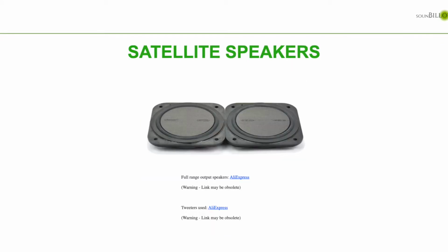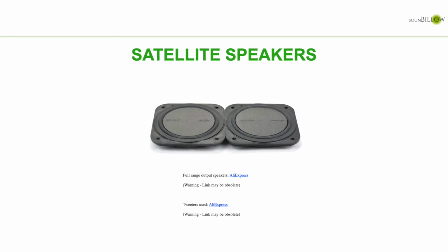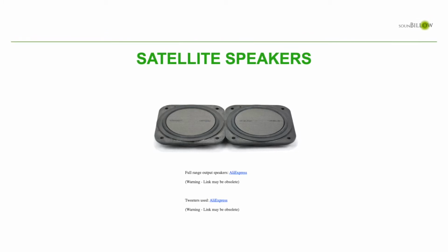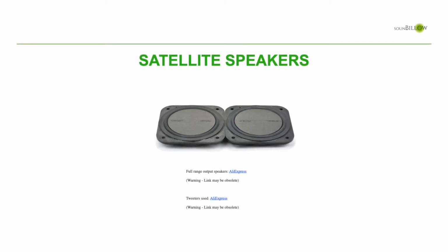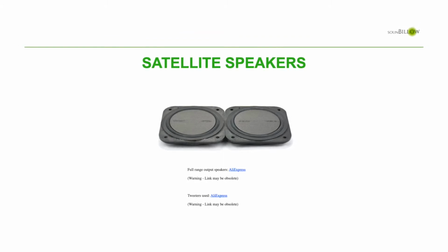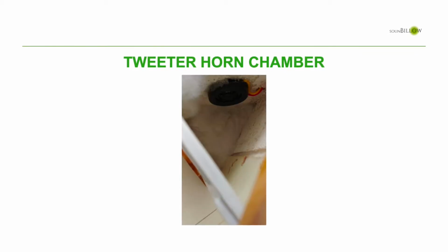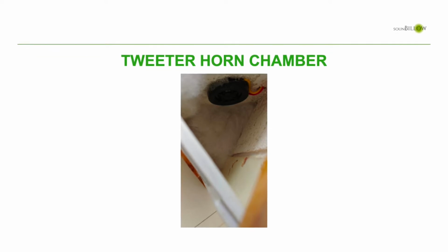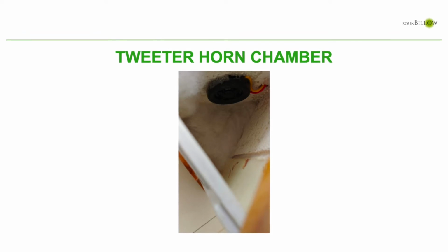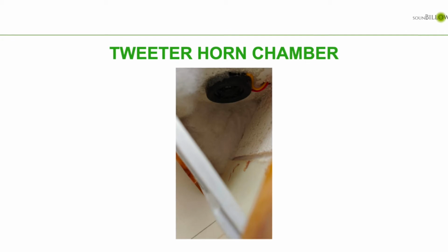The main 45-degree angle speakers render a virtual surround effect, and the difference is clearly noticed with the coaxial and optical input source with Dolby audio mixing signal. These main speakers are flat type with good mid output. Optical input is tested, which accepts the Dolby audio input source that will be downmixed. The main speakers are 3-inch in size, flat type, able to handle up to about 15 watts of audio output.